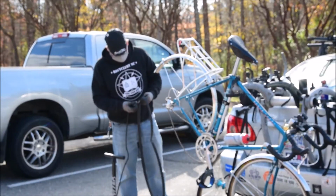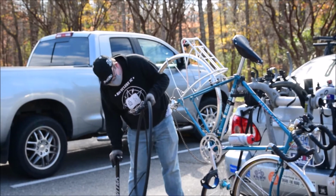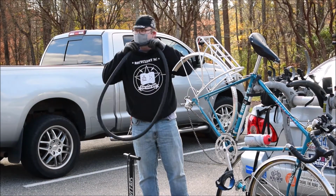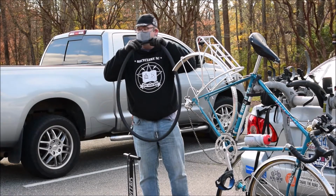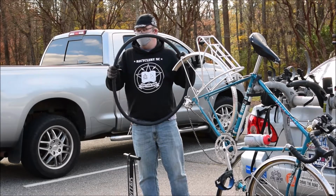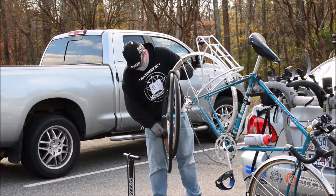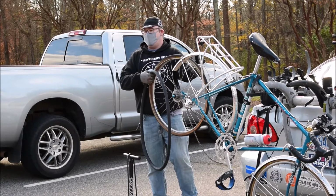The key to this, basically, you want to reinflate that tube just enough to give it pressure and listen really carefully, like hold it up to your face somewhere that's sensitive so that you can feel the air, if not hear it, as far as where that little hole was that poked its way into your tube. Once you found it, let's say the hole is right here. Hold it up next to your tire, find that spot in the tire, and then search around in there and make sure that there's nothing sharp that got embedded in that tire.